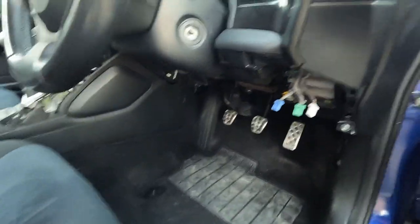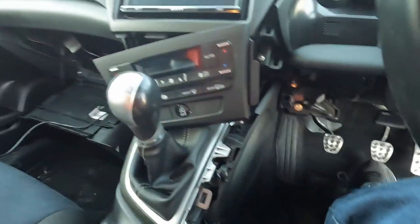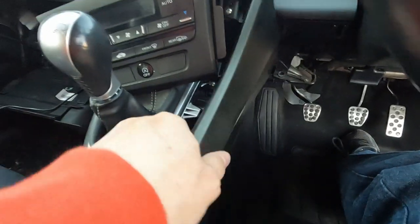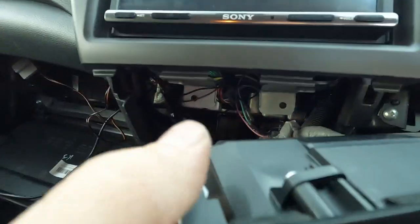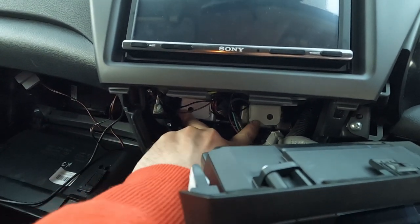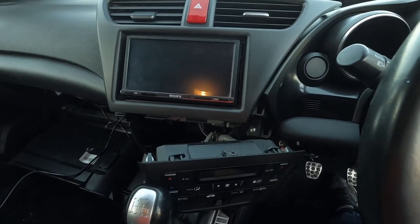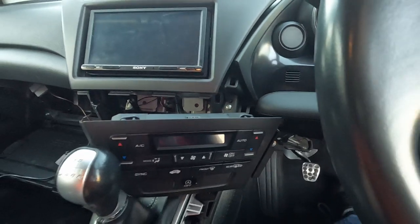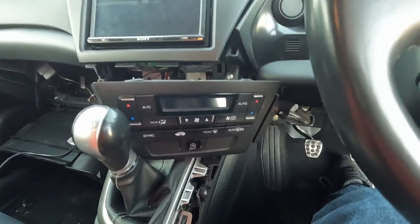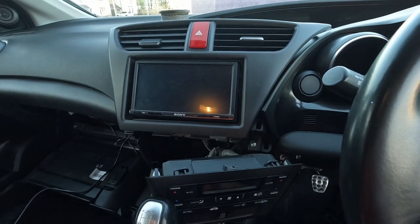Jumping back to the other side: you can pull that dash panel off, and the bottom one pulls off as well. That exposes a screw — you take that screw off and then this trim panel can pull off too. The climate control unit isn't screwed in with anything, so that just pulls out. In the back you can see two holes — that's where the head unit screws in with Phillips screws. The original head unit whole dash panel pulls out. You transfer over the vents and hazard switch, put the metal plates in, and fit your head unit. One more thing: you can take the plastic clips off your original fascia and put them onto the new one — it makes a better fit.